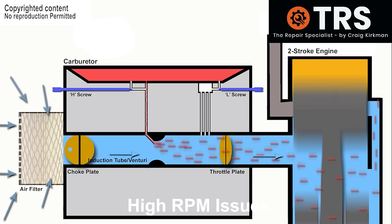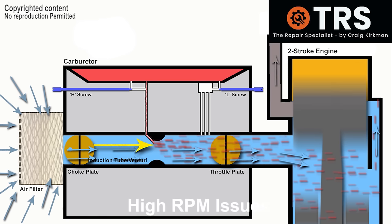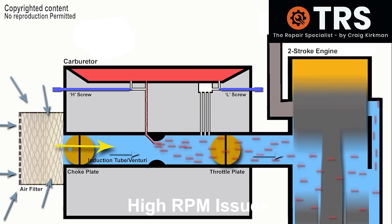Certainly in this case with incorrect fuel adjustment screw settings, where the high screw is screwed too far in, even with the throttle plate wide open there's no extra air going through the carburetor because there's only so much fuel allowed out of the main jet. That amount is enough for idling speed, but because there's only this amount allowed out, when the engine needs more fuel it's not going to rev up — there just isn't enough fuel for higher engine revs. Without sufficient fuel for maximum revs, the engine's not going to draw in maximum air through the carburetor — it's a knock-on effect.